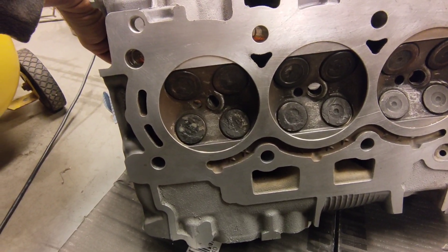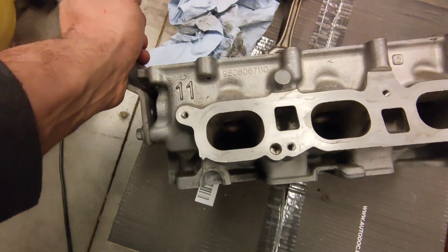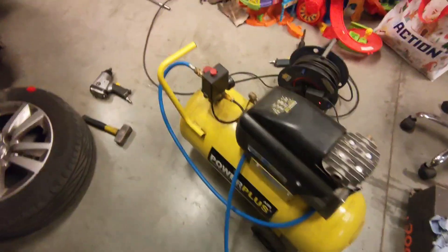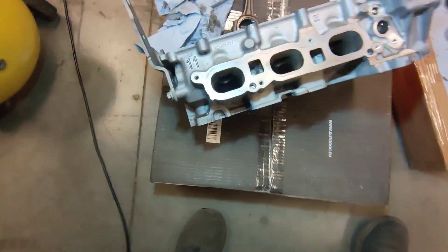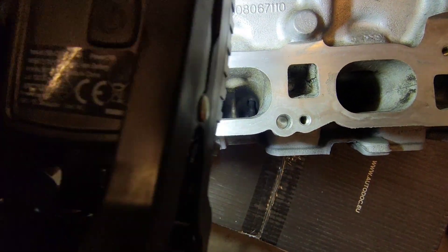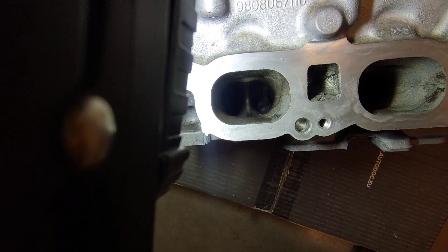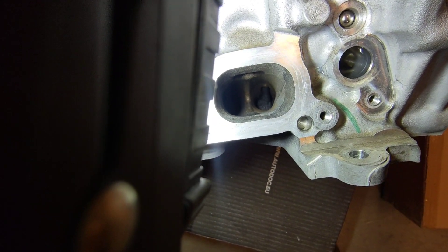We did the bottom as well. The cylinder sides, as you can tell, are not perfect but they're better than they were. I might take a wire brush to them tomorrow with a drill. I've had a look inside the ports - it's a direct injection engine and they are known for having gunk on them. I scraped off most of it with my compressed air tool while blowing compressed air through them and most of it came off, so I'm happy with that.